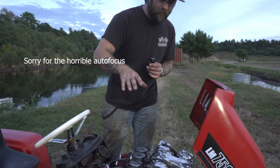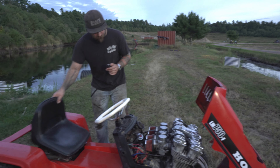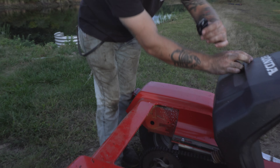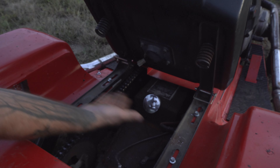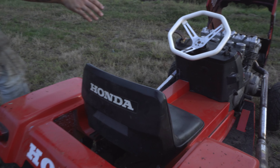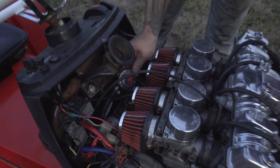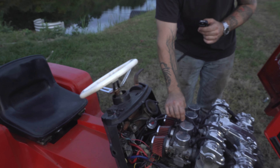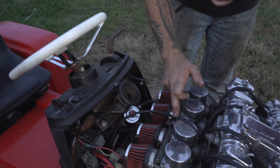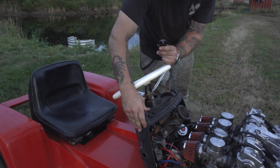Street bikes have a gas tank over the engine so it's gravity fed to the carburetors. I can't do that on a lawnmower, so what I had to do is — under the seat — there is a fuel tank from a wood chipper that I cut in half and welded to a plate, which is the skid plate. I've got a 12-volt fuel pump feeding up to a little Amazon pressure regulator set at 2 psi. It works perfect, doesn't overflow the carbs. The choke and throttle all needed to be modified, but it works — choke is right here, just a regular pull choke, throttle linkages work, everything works great.